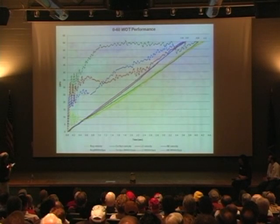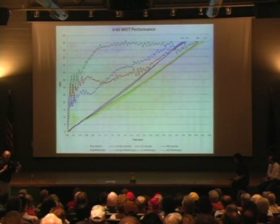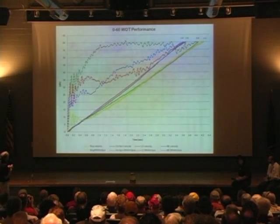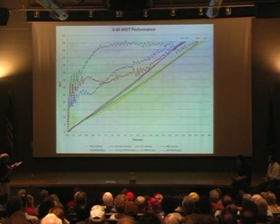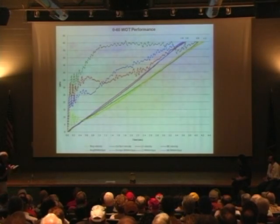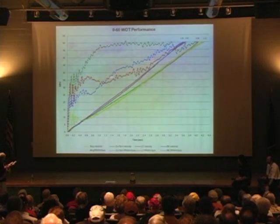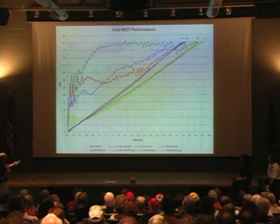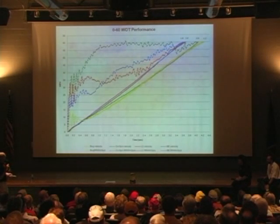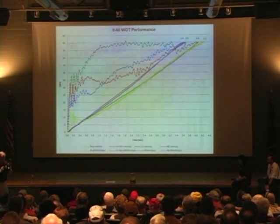Now, the absolute optimal one — that's this one in blue here — best effort. That's Luke on his best day, where the rear wheels are just going a little bit faster than the fronts. Just before it hooks up completely, that's where you actually have maximum traction. He's got the rears going just a little faster than the fronts most of the way out, and on this run he ran 3.6 seconds. That's a little faster than what we advertise the Z06 at — 3.7 — but depending on the day and the track, that's what he happened to run. With the system on, you can see it doesn't follow the exact same pattern. You get a little more spin-up at start, but then it pretty quickly gets back and tracks similar to what Luke does, with the rear tires spinning just a little bit faster than the fronts. You get a no-brainer way of getting a 3.65. It's a hell of a system, and like I said, your warranty stands — unlike some other cars.